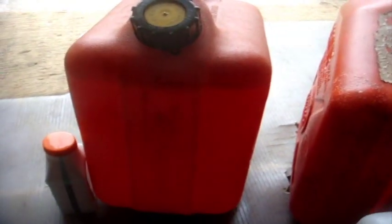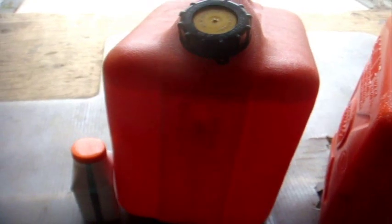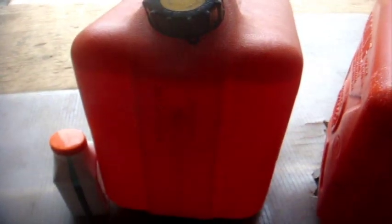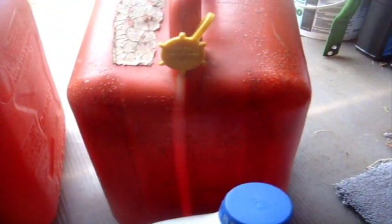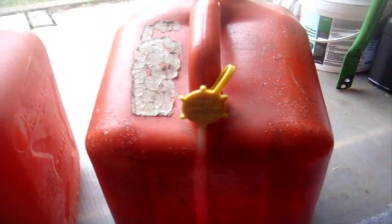Okay, so in here I have my 2 gas tanks. These are both 10 liter. The only difference is that one of them is filled up to 10 liters and the other one is filled up with 8 liters. So to make a 50:1 gas oil mix for a 10 liter tank full of gas, make sure you use at least 89 or 91 octane. You would use all this 200 mils, and that'll be good for the Stihl and most of my trimmers when I start them up, hopefully when this weather improves. And for the Lawn-Boys, the 32:1 mix, I have 8 liters, but I'm going to be mixing a quarter of a liter, so that's 250 mils.